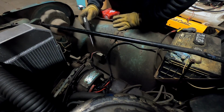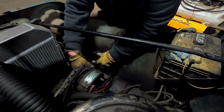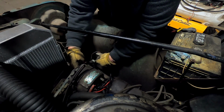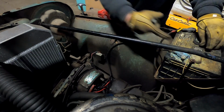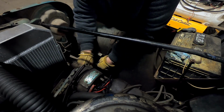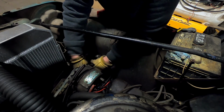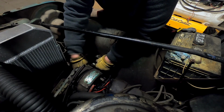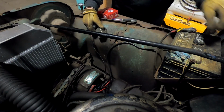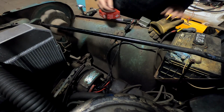Hey there. If you've been watching my channel for a while, you'll know that I've got an old '66 CJ5 with Dauntless, just my old beat up plow Jeep. You can see the battery is kind of not in, the battery cable's not in good shape, and this old battery's kind of trashed. But my voltage regulator I think isn't working, putting out some crazy readings. So I picked up a new voltage regulator and I'm going to replace it right now, and then I'm going to replace this battery as well and see if my voltage readings are better with a new voltage regulator.